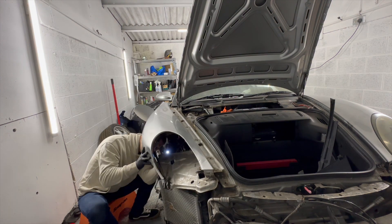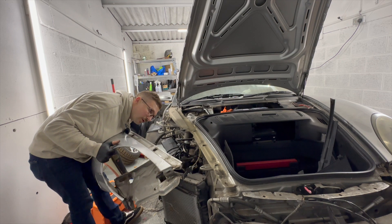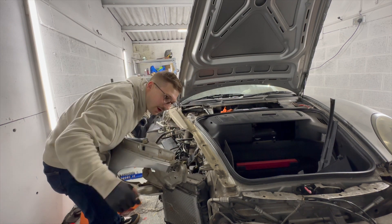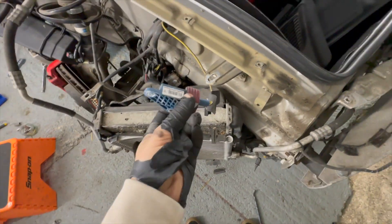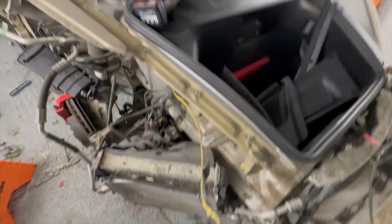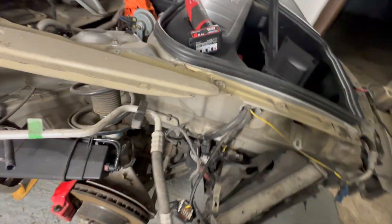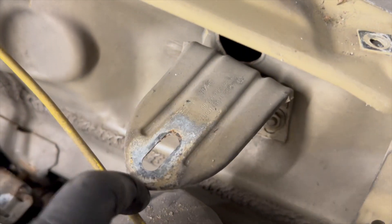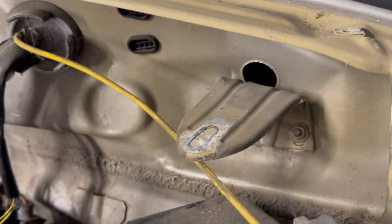One more bolt — and there's a crash sensor! That is the wing off. A little bit of a battle but I'm glad it's gone. I didn't know there was actually what looks to be a crash sensor mounted to the front corner of the wing. I'll need to look that up and replace it, because that would have definitely been the one to trigger the impact and deploy the airbags, being that the damage is on this right-hand side. So we're wing off — now we can see the whole radiator and condenser assembly. There's not actually too much left holding this on, but the crushed bracket has bent slightly.